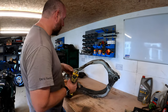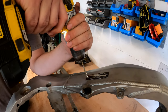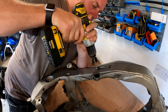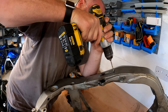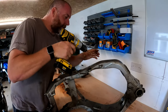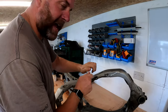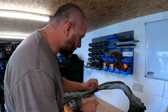The first thing I'm going to do is look at this VIN plate. I've got a sharp drill and all I'm going to do is simply drill the heads off these rivets. It's not actually taken the head off yet - it's made the rivet loose. So I reckon with a little chisel just tap the head off, and then that'll be removed. I've just got to be careful not to damage the plate because obviously then it'll look scruffy when it comes to reinstalling it.